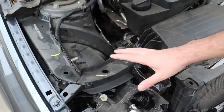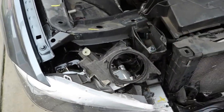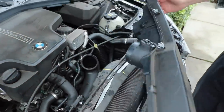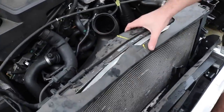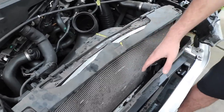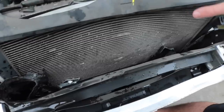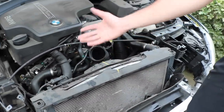We're going to have to take this down to our frame shop — they're going to have to pull that out for us. In the meantime, let's get all this wiring out of here, get these janky headlights, and take off things like this air box that's not even connected — we actually found it in the trunk. We need to remove all this stuff: the radiator, all that got smashed in. The good thing about the F30s is the radiator support is not a complete piece — it's multiple pieces. Once we take this all apart and order our new radiator supports, we're both super excited. Let's start tearing this thing apart.